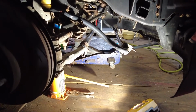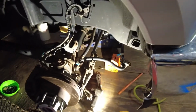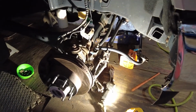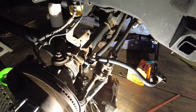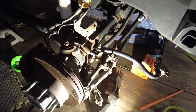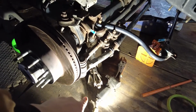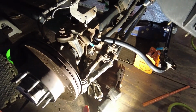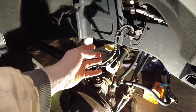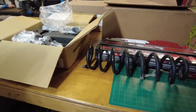We are back, we didn't get it fully recorded. We're just going to explain it. It was something that we needed to do a little problem solving. So our bottle jack down here was a little bit too tall. We needed the axle to still go lower. So we just got a scissor jack, like the one you'd have to change a spare tire on your car, to lift up a little bit. We moved the bottle jack and slowly lowered it some more so we had enough space to actually pull the whole entire spring out, which you got over here, right? Boom, we have spring out.